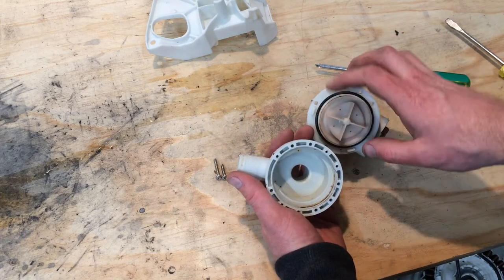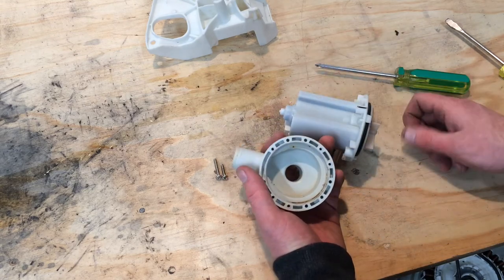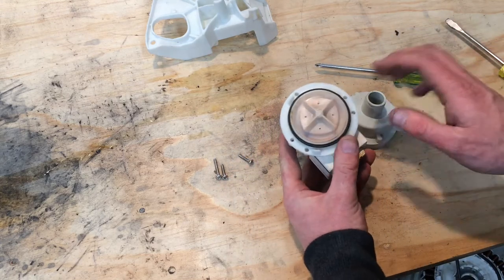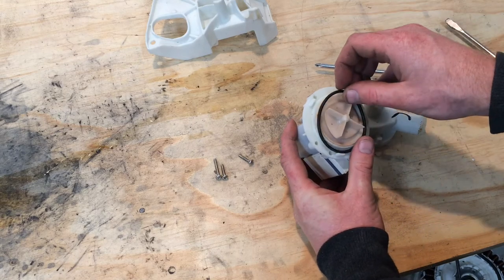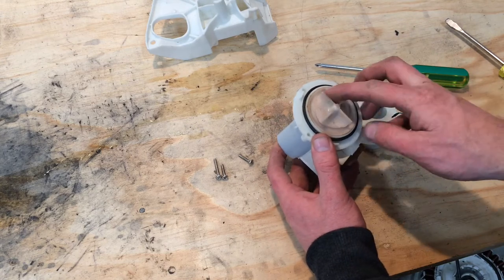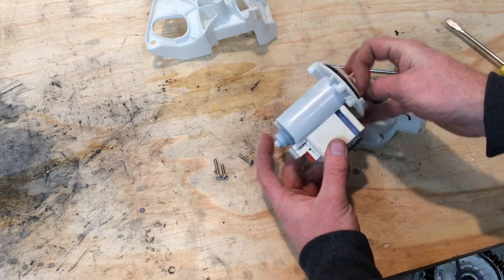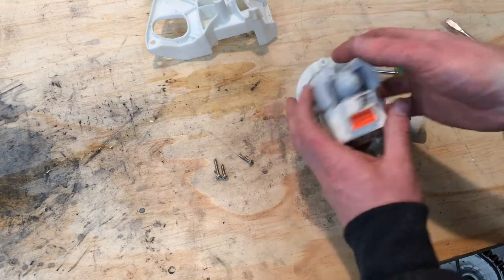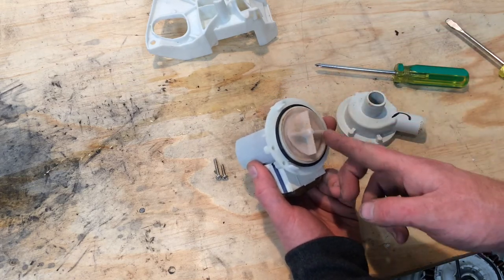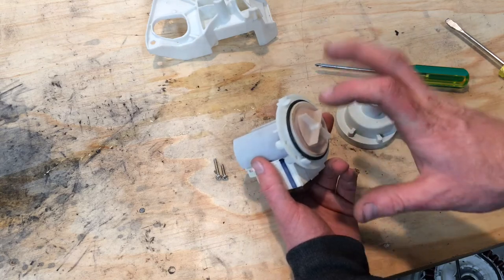Usually in here is where you'll find a piece of hair clip, a pin, nails — anything that's blocking it — or you could have bits of fluff. This is where you're going to clear it out. There's an O-ring that sits on the pump that's quite important to have. Notice this doesn't actually turn smoothly — all these drain pumps are similar. They're what they often call a synchronous motor. The pump will turn almost 180 degrees without much obstruction and it kind of flicks over and goes in pulses like that, and that is entirely normal.